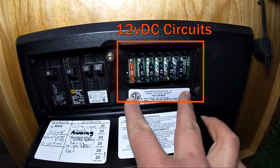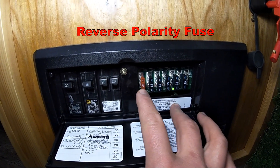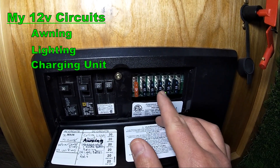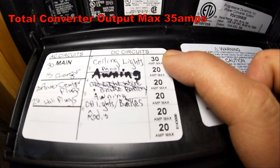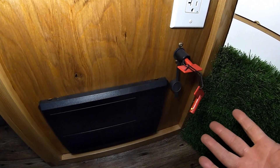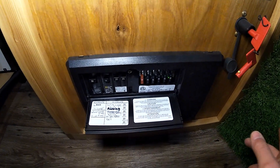This half here is all of your 12-volt direct current circuitry. You can have up to six circuits. This is a main battery fuse — if you somehow reverse the polarity, this fuse would protect everything. I've got one circuit for the awning, one for lights, one for this little unit I have up here for charging your phone, and one for the radio. The first circuit you can go up to 30 amps; the others are all 20. This is just a battery disconnect switch. It's on right now, so I can turn it off and my 12-volt lights stay on because this converts 110 to 12 volts DC, which is pretty cool. When I turn the battery back on, it begins trickle charging the batteries.